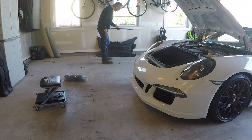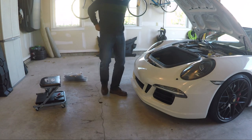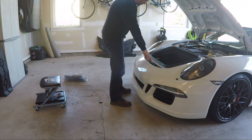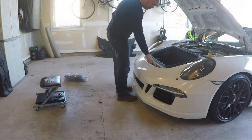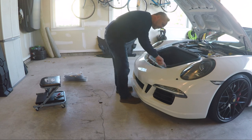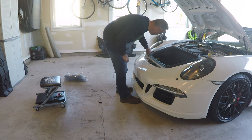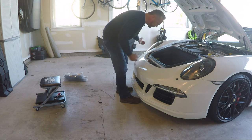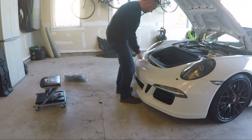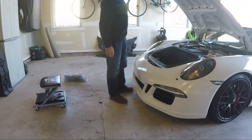So far so good. This piece is in good shape, just a little dirty — maybe I'll treat all those pieces before I put them back on. You can see the three T25s here. The clip for the headlights is right inside these two edges. Once you get the headlight out, you pull these clips and that's the final thing to release the bumper cover.